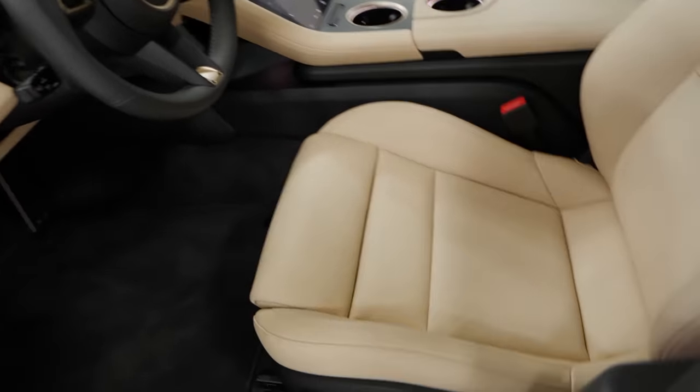Okay, when we started this platform, the Mercedes-Benz High Architecture, we decided that we want to have really separate car lines. So that means the GLE is a basic version. The GLS is focused on the comfort and noise, vibration and so on. And the GLE Coupé is a sporty one. So, to get the sportiness of a car, one of the major issues is that you have a separate wheelbase. Because the shorter it is than the basic version, the more you get for the specific adaption of the suspension system, for the drivetrain, for the chassis and so on. But the basic situation is a shortened wheelbase.